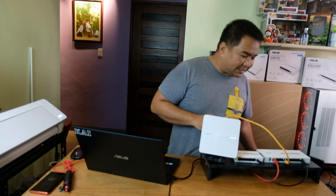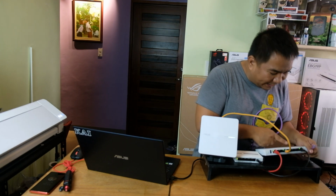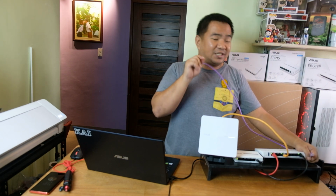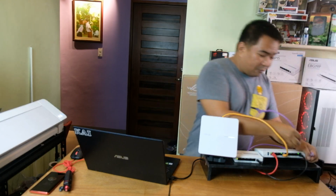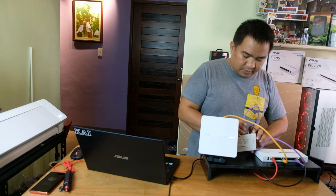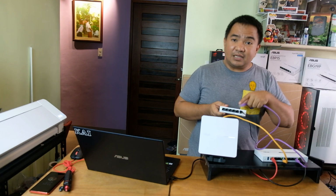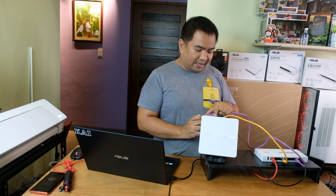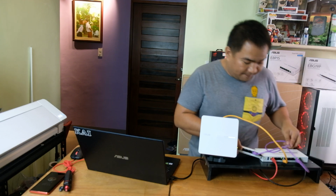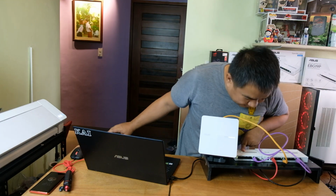So you only have to plug one from the main to this smart switch. So for example, let's see in here. Remember that port 8 is configured for access for the VLAN for the JKchavez coffee. We will be plugging it in on that one, and plug it on maybe the last port, because guys, the last port for the EBP15 doesn't have any PoE capability, so we will be using that one as our connection from the main. Okay, so currently it's still connecting with that one.